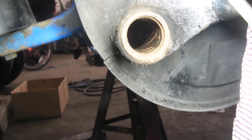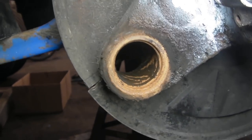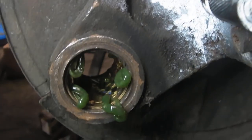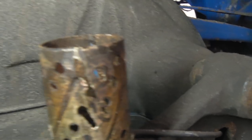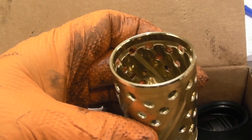Here is a cam bush. You can see this is actually bone dry, even though I've dragged it through and there's a little bit of damp on there from the end of the camshaft when I pulled it through. This is not acceptable because it's actually rusted. The rust expands and then the camshaft doesn't move very smoothly. Removing the bush — you can see it's made of brass, and inside there it's bone dry and rusty. There's a lack of lubrication. When it's greased, the grease should come to the front and then slip back. I've had to do this with five out of six camshafts. This bush has either been missed or the water has just washed the grease out. The replacement bush has a slot where the grease goes and it will travel all the way to the front and then to the back again, giving it enough lubrication to operate properly.